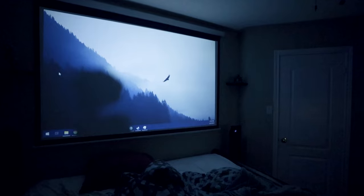What really sets this projector apart is the ease of setup. What this projector has that the one I reviewed in the past doesn't have is digital zoom and keystone correction — 50 degrees in both horizontal and vertical adjustments. What that means for you is that you don't have to have your projector perpendicular to your screen and you have more flexibility in where you put your projector. In my bedroom, I had this projector set up on a shelf in the corner of my room, tilted towards the projector screen. With keystone adjustment, I was able to get the actual image roughly square or rectangular. Otherwise, without keystone, you'll get a trapezoid effect, which isn't really 16 by 9 in ratio.